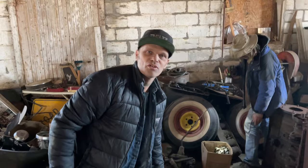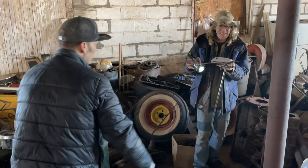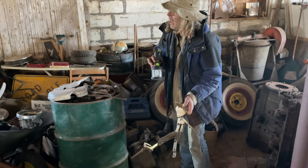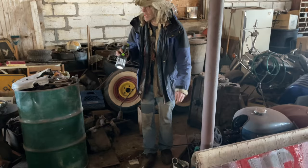And this is all Hudson, too. I just moved that. I picked that up, moved it right there. That is the brake, emergency brake combo. Hudson had it set up so when you put your brakes on, the emergency brake cable came on. Oh, wow. There it is right there. That's not a bad idea, but that's how they did it. It kept the cables from seizing. That's what I was thinking. At least you're using it.